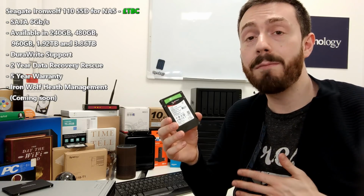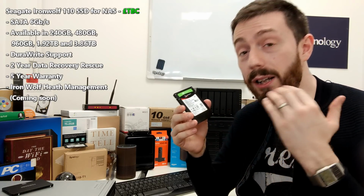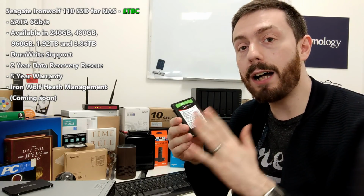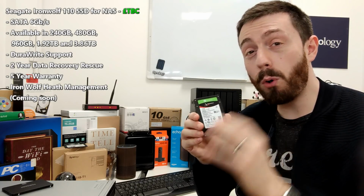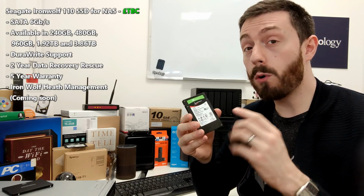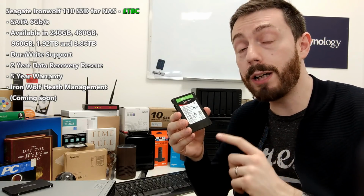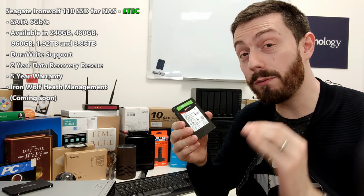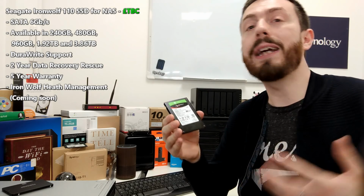So when you are writing data to an SSD, speed of course is paramount, but early SSDs, because they spent less time worrying about data being laid out, meant that in the smaller capacities that SSDs arrive in, data was very poorly laid out inside. They could have beefed up the controller inside, or used a better controller to handle and lay that data out as well as possible on the NAND chips, but that would have bottlenecked performance ever so slightly. So they tried to avoid that, because when it comes to people buying SSDs, speed is always the big selling point.